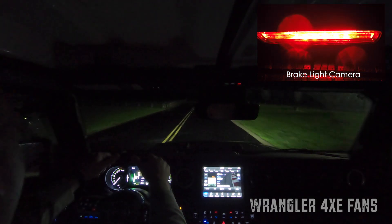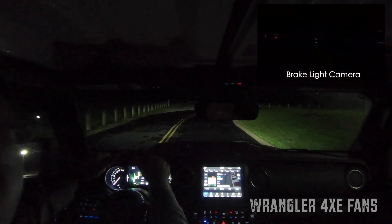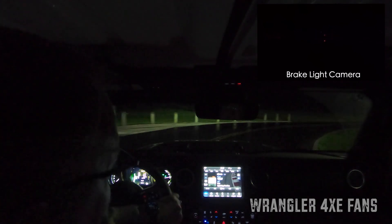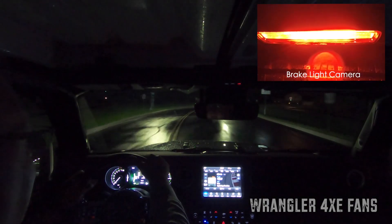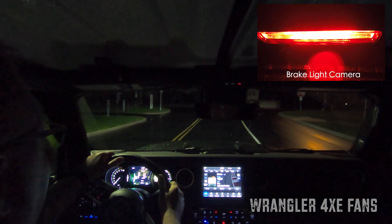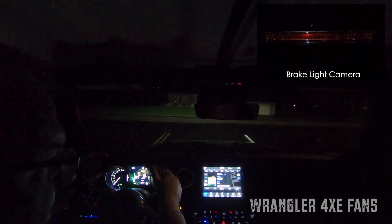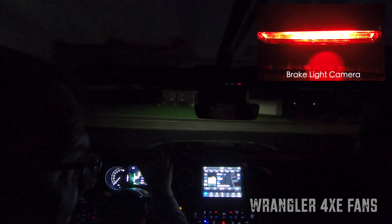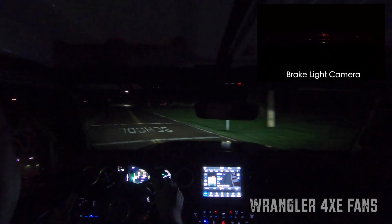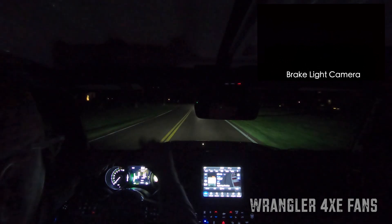So if I let off right now, the brake light came on. And if there were somebody behind me, they would know. But if you were on the highway doing highway speeds, you're going to be flashing that brake light at people — so just be aware of that. As I come to this stop, I'm going to try to time it well. I'm just going to feather the pedal a little bit to where it slows down at a rate that feels more natural. And there the max regen just let off — now I'm in creep mode. And I just used the brake pedal in the last few feet there for the stop sign. Just wanted to give a demonstration of how that works so you know that brake light is coming on and letting people around you know.